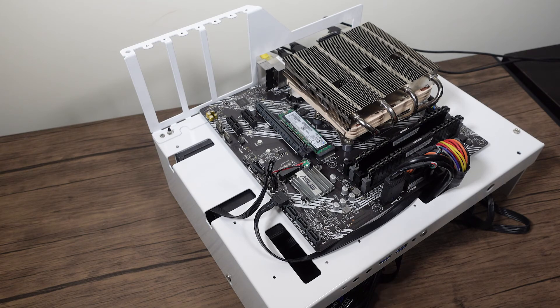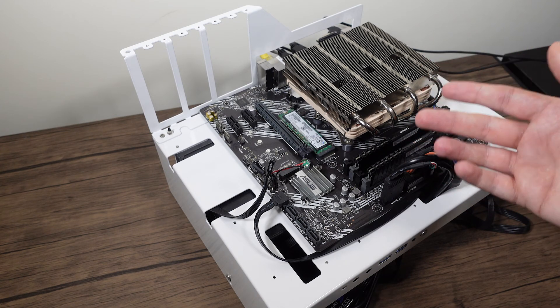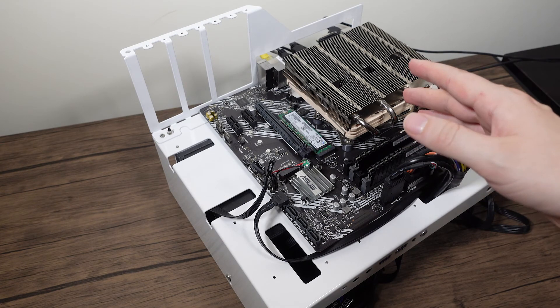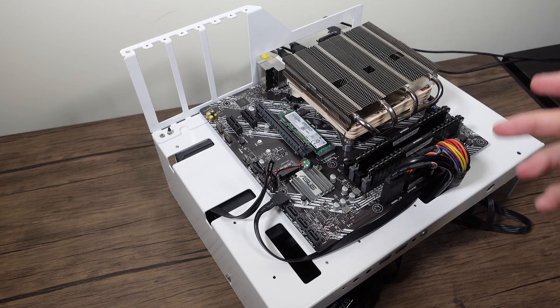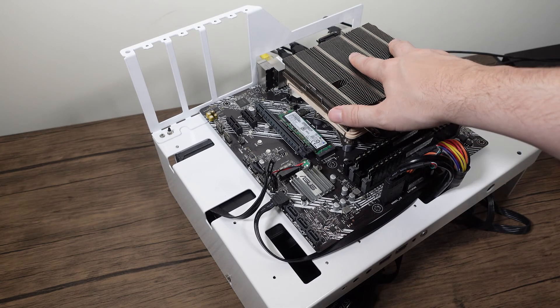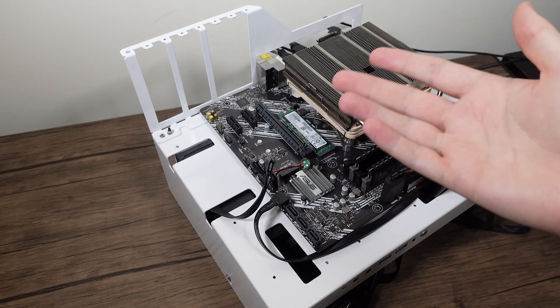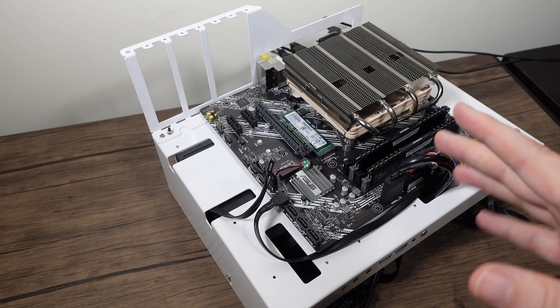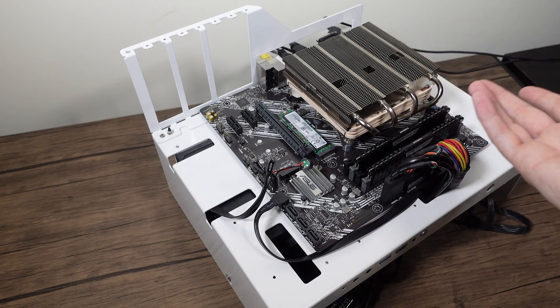We save about five watts over the course of an hour, which adds up over the year but isn't amazing. I wouldn't class this as a 35-watt TDP CPU. Based on what the 4300G does, I think 35 watts is a bit of a marketing gimmick. This is closer to about 45 watts, whereas the 4300G itself is probably closer to around 55-60. Calling this a 35-watt CPU is misleading because at the wall it can draw over 70 watts at peak, which is much more than you'd expect.